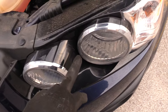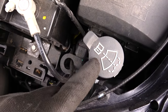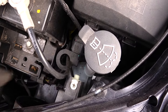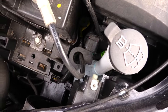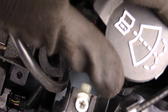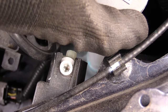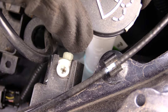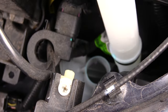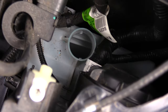To remove the actual headlight — this one right here — you first need to remove your windshield wiper fluid reservoir cap so you can reach back there. You'll see it down there; it spins. Spin it toward the driver's side door like that, then raise it up and it'll come right out.